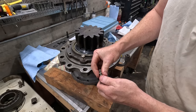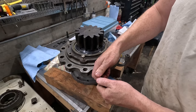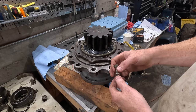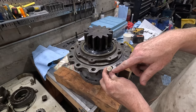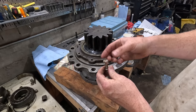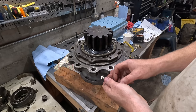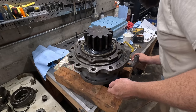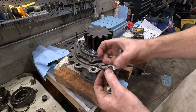Now, should probably replace these lock washers. I'm not really sure what's going on with these bolts. They're a little bit different than all the other bolts on this device. They also have three markings on them, like they're a grade 5 SAE, but they're metric. They're threaded as metric. A lot of them are, let me find one here. Some of the threads are like this, they're bad.